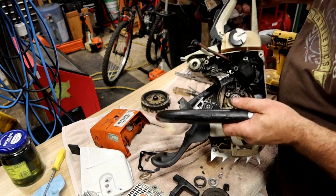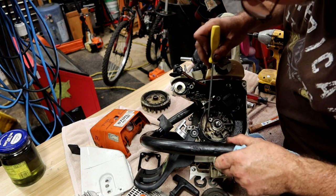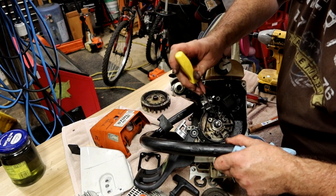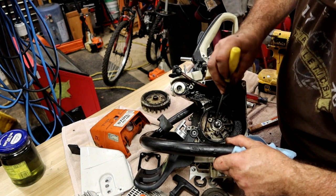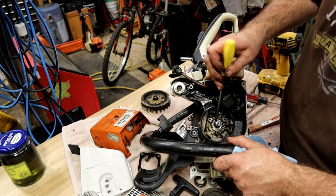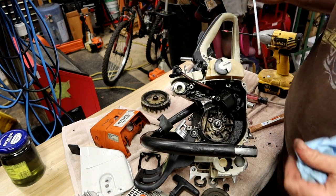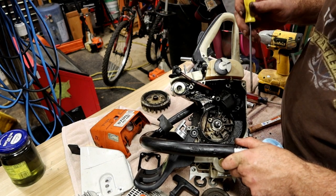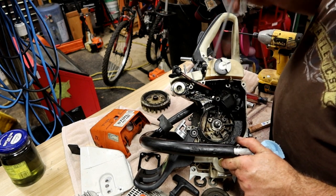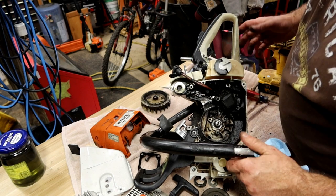So what I don't like, now this wouldn't have been from the original guy who installed it, because he didn't do this part. Should have, but he didn't. But these OEM seals, when you see oil and gas inside this area, it's almost always because this seal leaked. They do leak, and they will run lean, and they will cause a bunch of problems. And if you're changing this one, you always change the other one. You change them out in pairs, not just one.